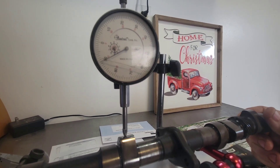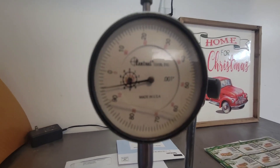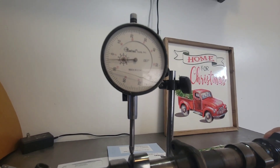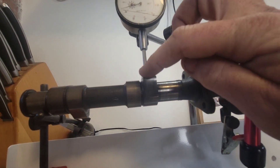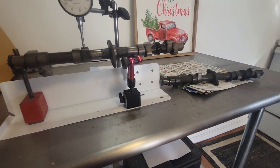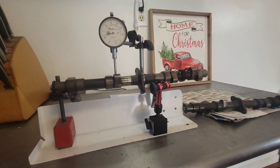Just measuring this cam across the lobe to see if it changes at all. Yeah, see it changes when we get up over here. Oh yeah, look — this cam is a bit worn. It used to be way up there; they were a bit worn on the lobe, but that's okay. All the old camshafts have the exact same wear on them. Either way, all the camshafts are going to be worn the same, but this one definitely has a bit more lift to it. More lift is always a good thing, especially when we're trying to get more boost in — more lift lets more boost build up.